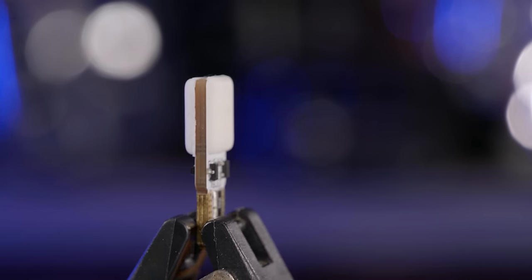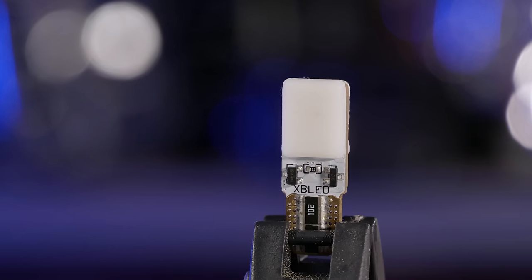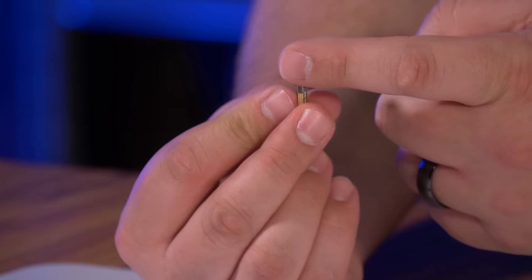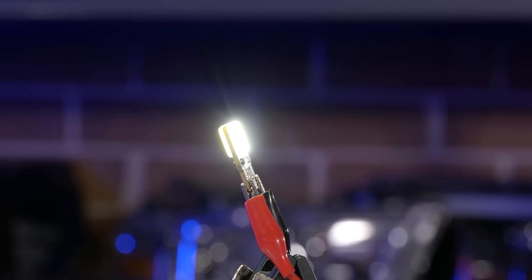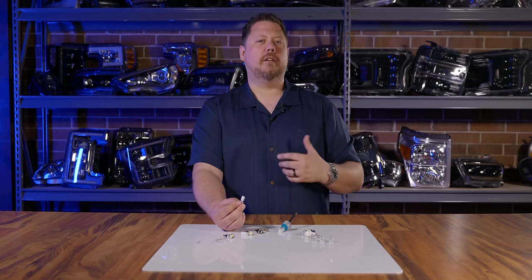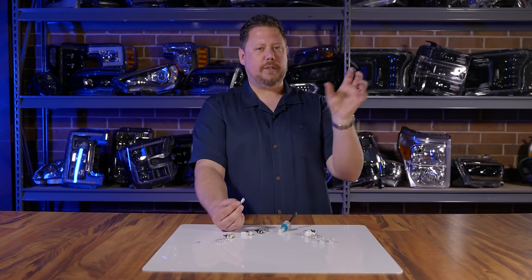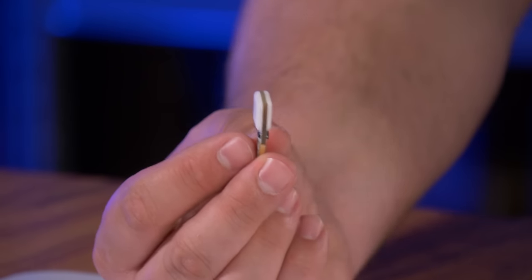Now let's talk about facing left and right — horizontal distribution. Something like this bulb from Morimoto is a really interesting option. As you can see, there's nothing shining out the front — all the LEDs are surface mounted on each side of the PCB. The white cover over it is simply for dispersion so you can't see the individual LEDs and you get a nice glow instead of seeing individual chips. If you have an application where light shines straight down or you need to use reflectors that are left and right, something like this T10 from Morimoto is a good option.